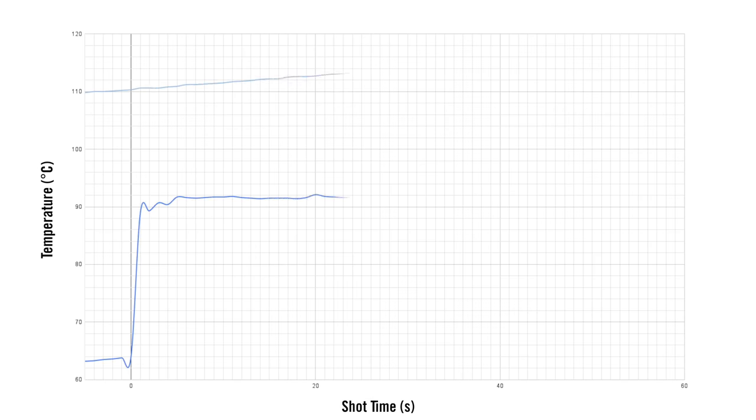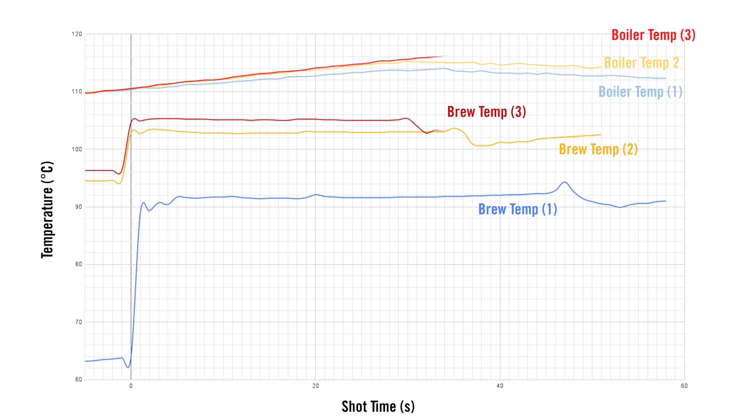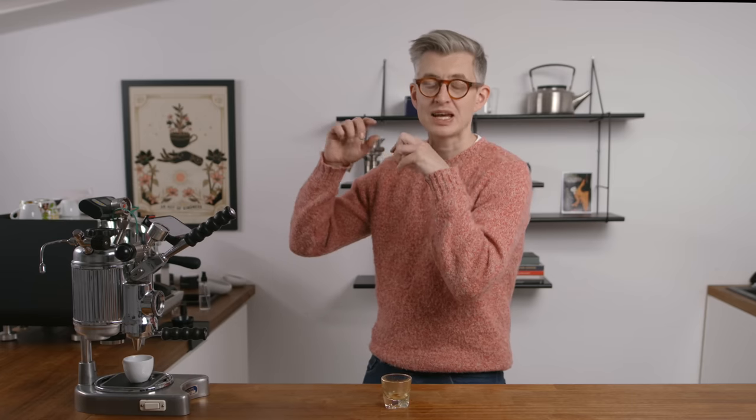Here is the temperature data for three shots pulled back to back — in between I'm running the boiler in min mode rather than max, so that each time the boiler temperatures are kind of similar. But you'll see as one shot to the next to the next, we go from sensible brew temperatures up to very high brew temperatures, up to unusably high brew temperatures. Now that I know I've got this really small window between the boiler getting to the right temperature and the rest of the machine overheating, I find the machine more frustrating the more I know. I worry about analysis paralysis — people have loved and used these machines for literally decades, despite the fact that they're really fussy and finicky once you understand what's actually happening under the hood.